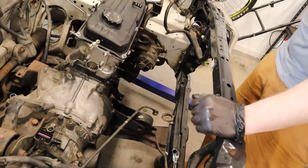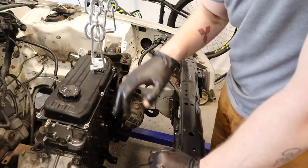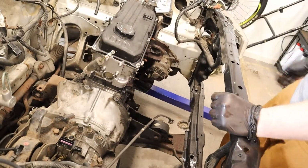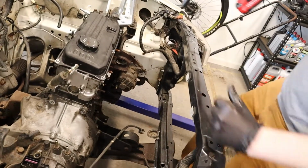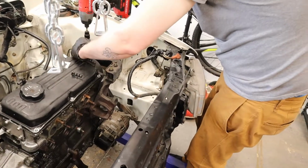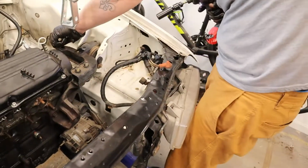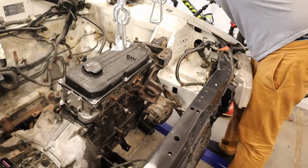Alright, so I'll just take this motor mount all the way off. That way we can use those for lifting points. Lower this down, connect the other two right there. Then we'll undo the other three mounts and lift it out. Theoretically. Oh, I can't wait to clean the rest of the engine bay. Didn't think it would drop that much. You might want to go ahead and get this side connected though, before you take the rest of it out, just in case. Yeah, I'll do that.